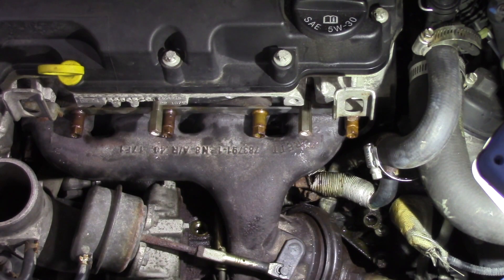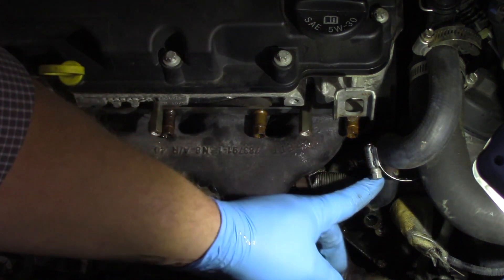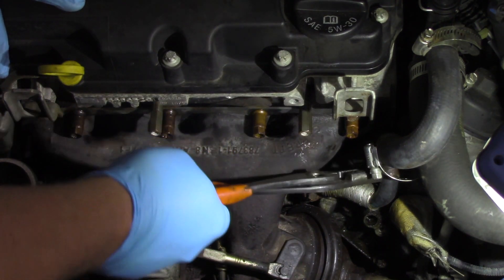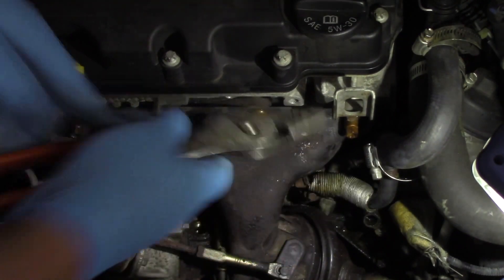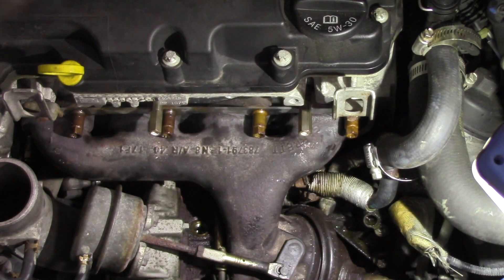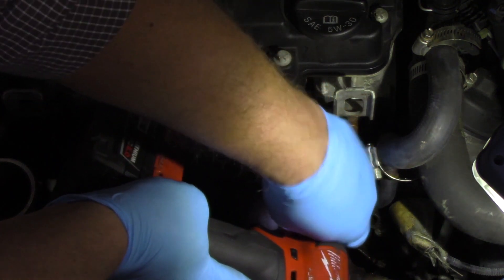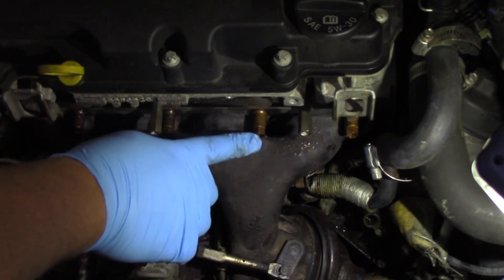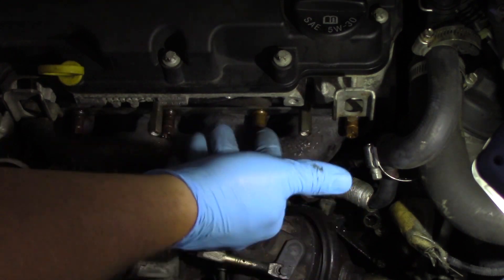Back on the top side of the vehicle — one more thing regarding that coolant line. There's a hold-down clamp and a hose clamp here. I'm going to use pliers to loosen up this clamp and slide that off. Then I'll take an E10 again and remove this bolt that was kind of hidden behind the oil feed tube originally. That'll allow me to loosen this up and remove it off with the turbo. Then really the next thing is to remove all the 10 millimeter bolts holding the exhaust manifold to the cylinder head.